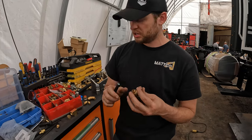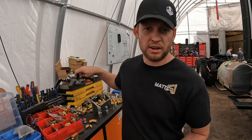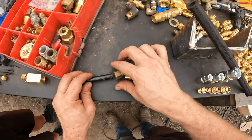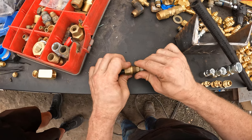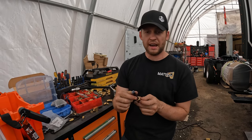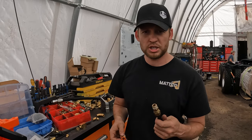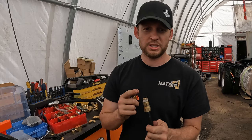The other option for nylon compared to the simple push connect is compression fittings. This is the most immediate upgrade if you don't want to go all the way to steel braided. What you do with compression fittings: put your end cap over the nylon, put your locking collar over top, then take the insert and slide it in. When you tighten it up, it compresses the fitting into the nylon and gives you a much better seal than a push connect. It's not going to leak anywhere near as much. You'll still have wear issues on the hose if it's rubbing, but it won't leak air like the factory quick push connects. If you just need to change a fitting, put a compression in — spend the extra 30 seconds and you'll save yourself a lot of headache down the road.